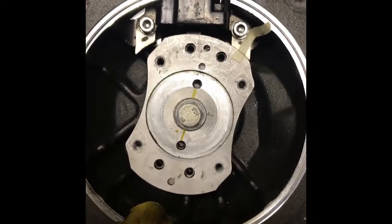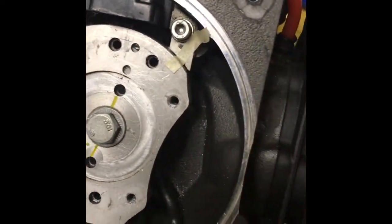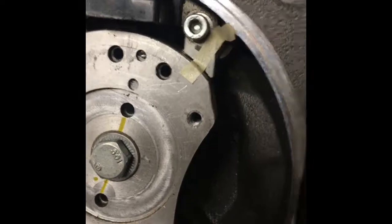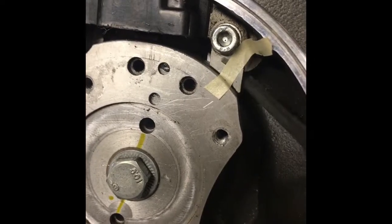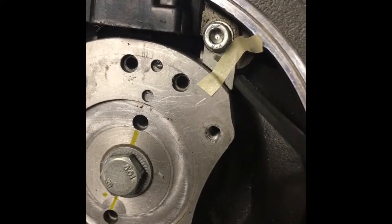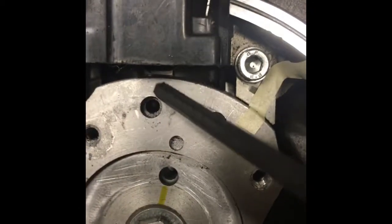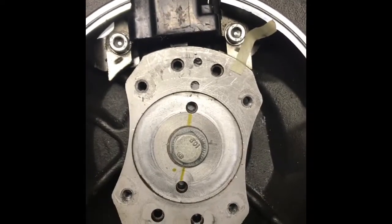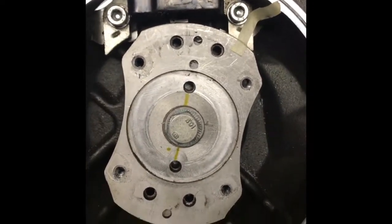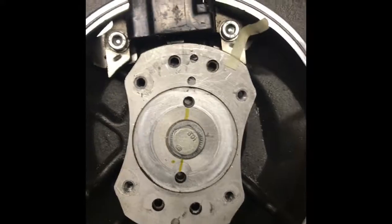This is what it looks like when it's stuck at top dead center with the timing. I put a piece of tape to mark it when I took everything off — it's almost flush there. This protrudes out just probably about a millimeter. There's a spark plug paper gap in between there. This is supposed to be top dead center. I'm just making sure the timing's set right because I'm still getting this thing overheating — going to about 500 degrees; 533 was the highest, at 7300 RPM.